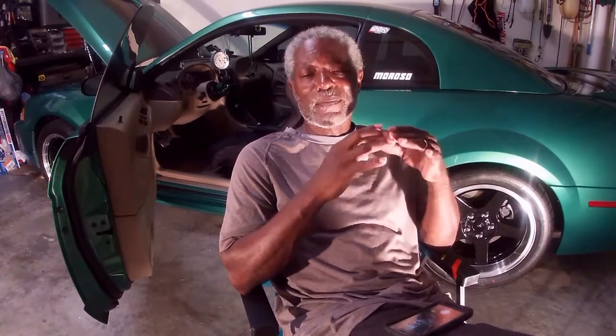And what sparked me to do that is the exhaust system that was on this car was probably on there about 5 years, and it was in good shape. Again, it had the regular manifold pipes from 99. They were extremely rusty, and it had the high flow catted X pipes, and then the Series 40 Flowmaster catback, the IRS catback exhaust system. The high flow cats were immaculate. They were very good. The Series 40 Flowmaster muffler was extremely good, but it was the manifold pipes that I was concerned with.